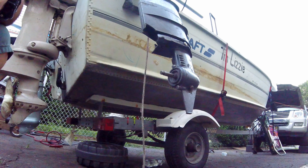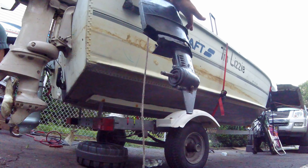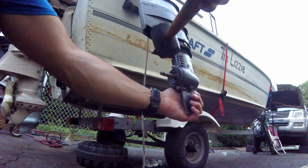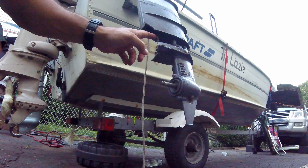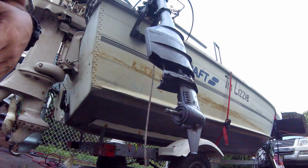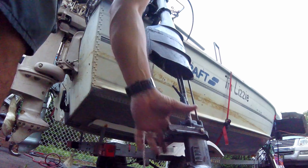Progress! We've been banging this thing, heating this thing, wedging this thing — doing everything possible. We thought it was the drive shaft the whole time, but it was this bolt here, seized up in there. So we cut this one and we cut this one — we'll have to drill and tap and put everything back together. But I did get it apart. Wow, what a job — this was not fun at all. It was all seized up in here, but I finally was able to get a wedge underneath it and it slid down. We can get the lower unit out now.